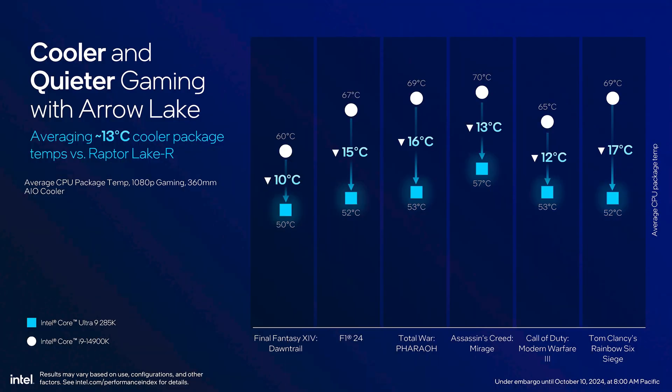Of course, for some titles that won't be the case. Something like Rainbow Six Siege, which is included in their 7-game list, really isn't an all-core workload, so dropping the power limit to even half of the stock limit just means you don't have as much headroom for other stuff in the background, but the game itself won't be affected. Compare that to something like Cyberpunk, which is a fair bit more intensive, and you might find a lower power limit will actually hurt performance. With that lower power draw, you do get a corresponding temperature drop — Intel is claiming a whopping 13 degrees Celsius drop on average compared to the 14900K, at least while gaming. For all-core workloads, both chips can draw 250 watts, so there isn't likely to be much thermal difference there.